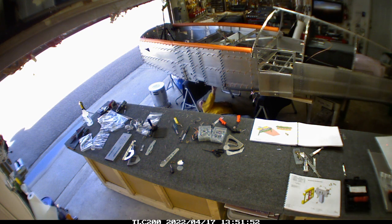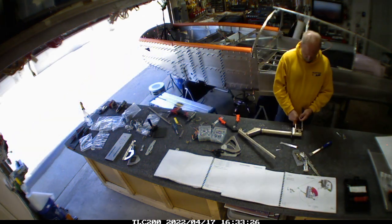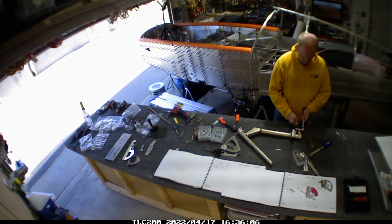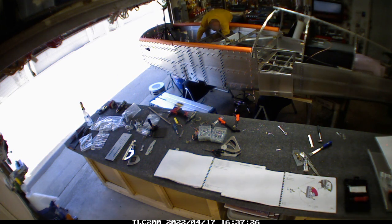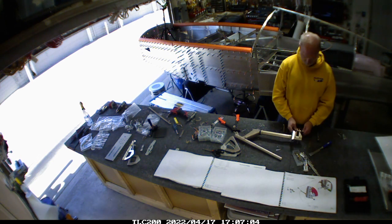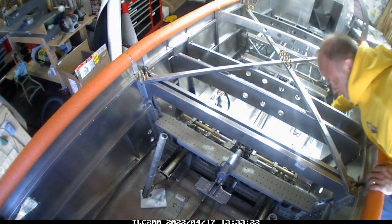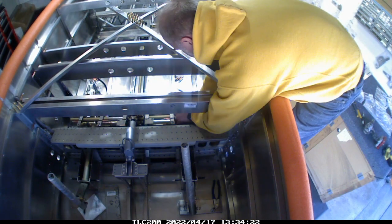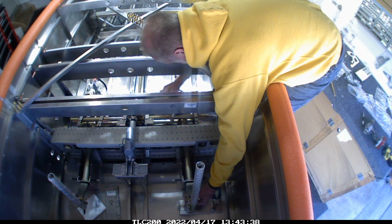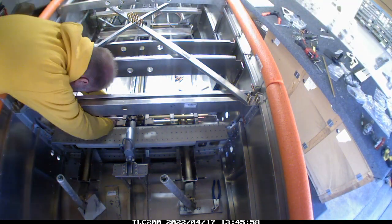I honestly forgot what I was doing in this section — I know I'm putting some rivets in but I'm not sure exactly what I was working on at that point. A little bit later you'll see me back underneath — at that point I'm riveting the rear fuselage to the front portion of the fuselage. Here I'm getting the eye bolts in place with their torque values. This is another one where even further along in the finishing kit is the additional eye bolt for the aileron controls, which would be really nice to have installed earlier rather than crawling inside the airplane to do it.